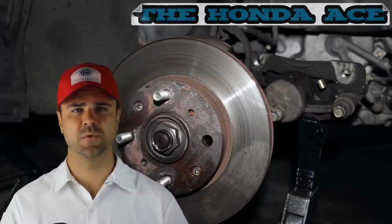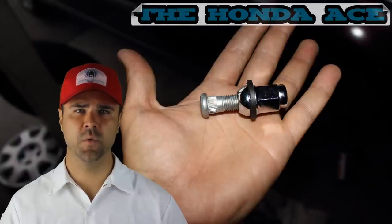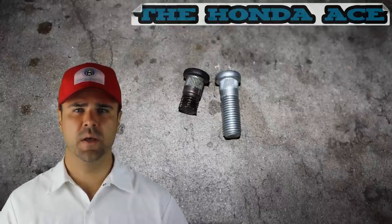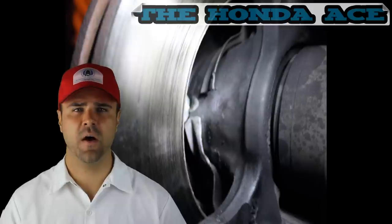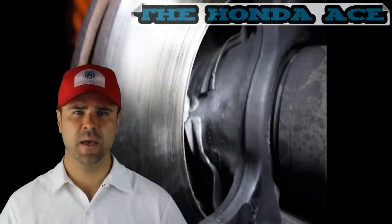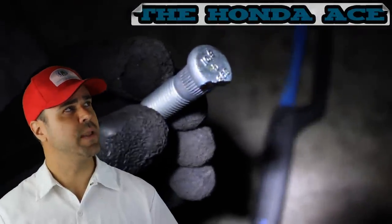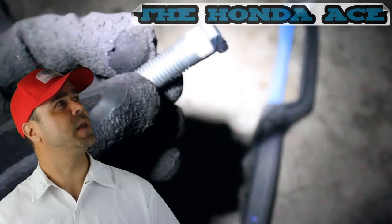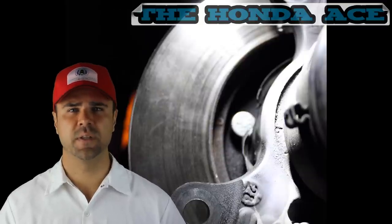Now that the old one is removed, it's time to install the new one. This is a little more difficult because the new one is the full length and the axle does get in the way. As you can see, the short one was the old one and it popped right out. The new one is not going to fit around the axle. So I went to the dollar store, got a saw, and had to cut off a little bit of the head just so it can fit around the axle shaft. I removed a little bit of the top — you want to line up the grooves when you put it in, so I had to remove a little off the top just to make sure it would slide past the axle.